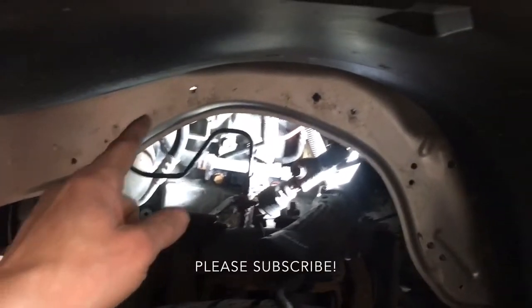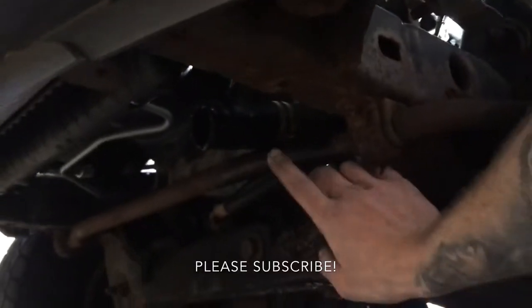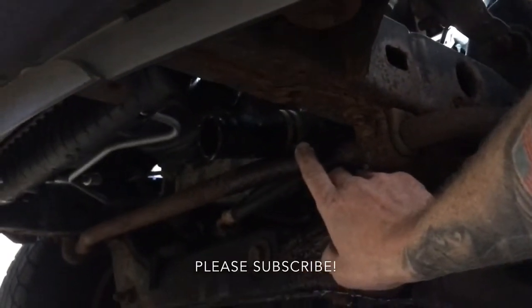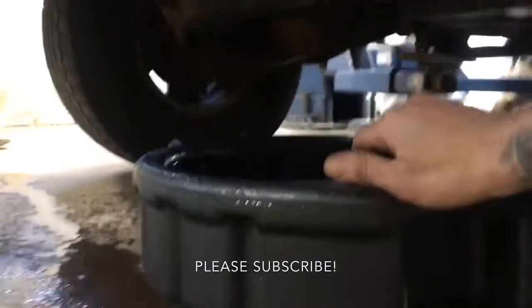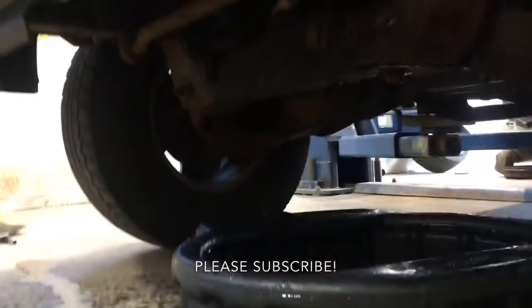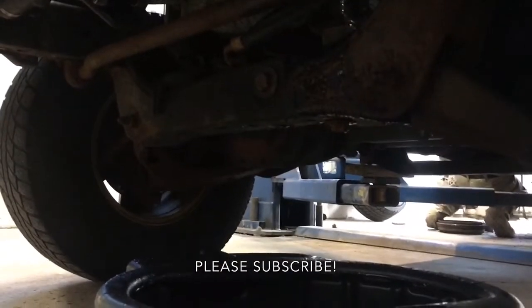The wheel well cover is just five or six push pins. After you do that, there's the lower radiator hose. I couldn't find the petcock on this radiator, so it's straightforward enough to just remove the lower radiator hose, which is held on by one clamp. Pull the clamp back, pull the hose back from the radiator, and it drains into a drain pan.